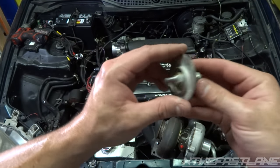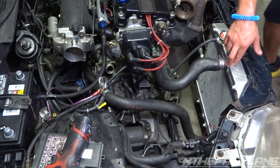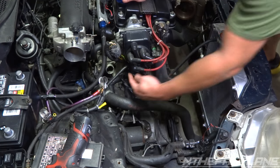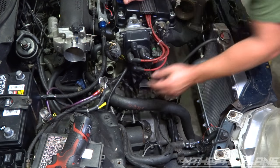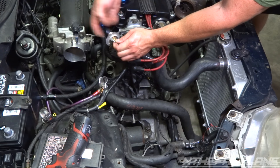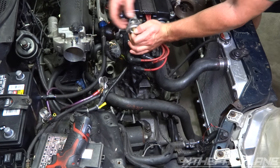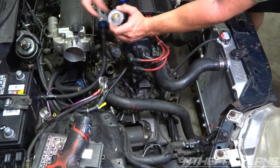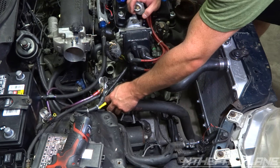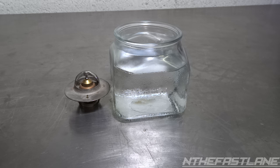In order to drop the temperature of the engine — as far as the radiator goes, this is the outlet, we'll call this the exhaust, and this the intake in engine terms. Here's where the thermostat goes — this is the nipple, this is the housing, and the thermostat goes just like this. Once this hot side gets hot enough, it hits the back of this spring and pulls it back, opening up this valve and allowing the water pump to start pulling in cooler coolant to cool the engine down. All you need for the job is a source of heat, a cup with water, and your thermostat.